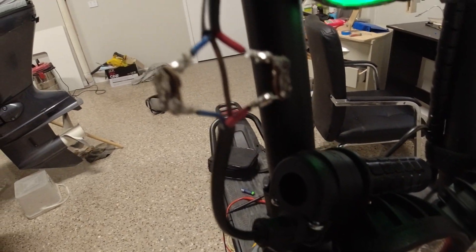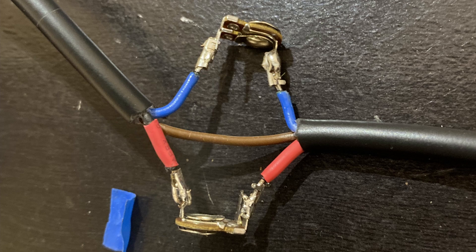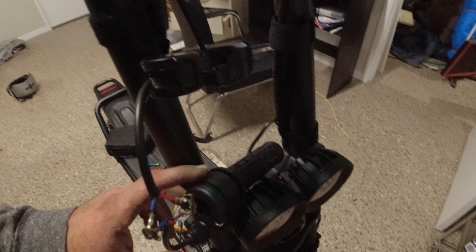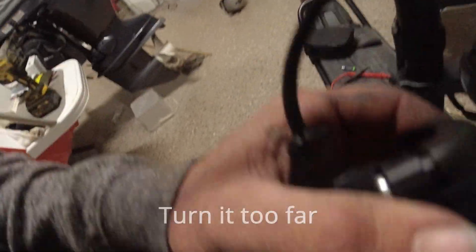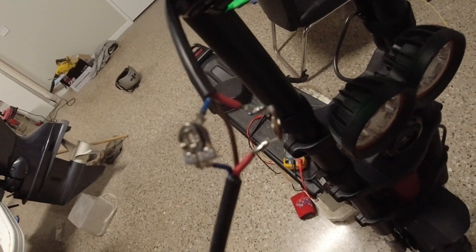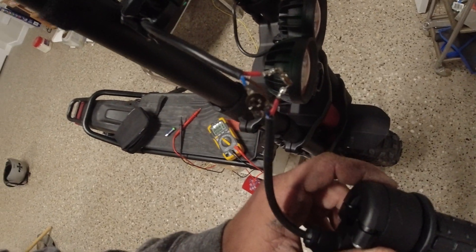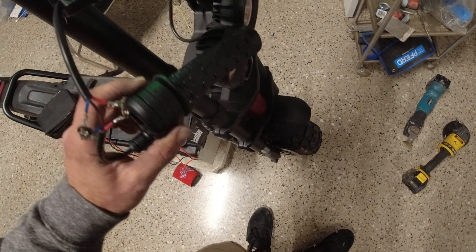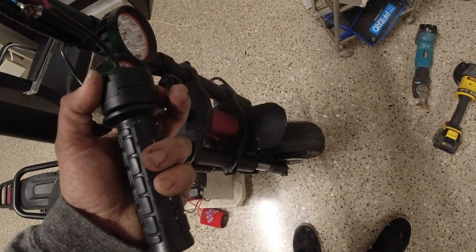After plenty of mucking around, I've tuned these. The 5k's work great. The blue one is at pretty much minimum resistance. The red one is about halfway around the trim pot to where I feel like the scooter was running before. For instant throttle, you can tune these — and the scooter, if you turn it, the scooter actually starts going without the accelerator. It was literally a game playing with these. I'm going to figure out the exact resistance we need on both wires in the future, and I'll definitely update the description on this video or do another video and mention it. This is a way to get it to work. I'll set the camera up and show you it twisting.